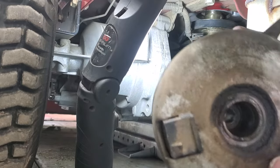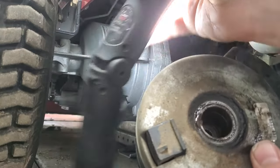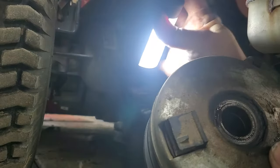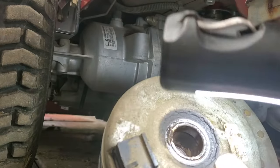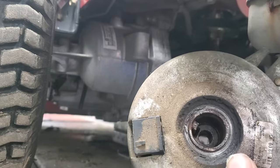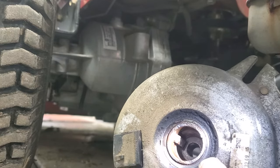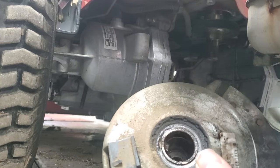It was nice and dirty, but you see here — just throwing that little bit of vibration from that impact, you could also do it with a hammer, just lightly tap, it does the same thing. Obviously the impact's going to work better. But that actually got down in all around your different crevices, around the shaft, and allowed it to come straight up off of there. That is the easiest way, no matter what, to get a clutch off. I've tried a thousand different ways and that'll get it off every time. Thanks for watching — like and subscribe.